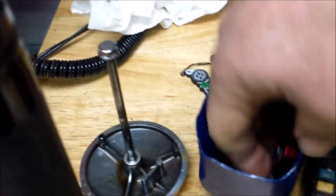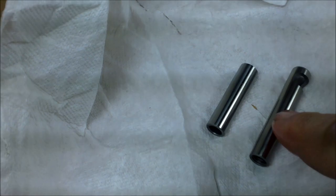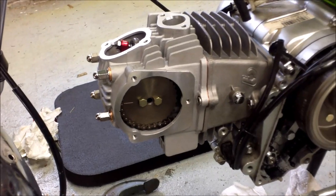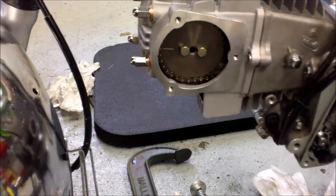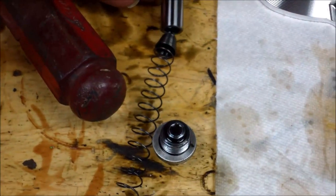A quick word about these roller rockers - I got them soaking in oil. When you put these in, you have your roller rocker and it comes with two different size pieces. The short one goes on the exhaust side of the head. Everything is together now as far as the timing chain - the sprocket and everything lined up. That was a bit of a pain getting the chain on that little sprocket. The chain tensioner goes in the bottom - the black tip goes up because that's the part that pushes on the tensioner inside, and then the spring with the cone end goes up, then the bolt holds everything in.